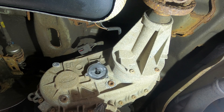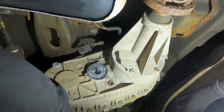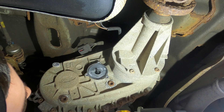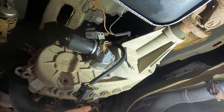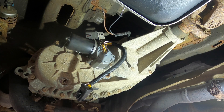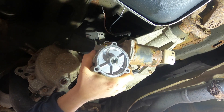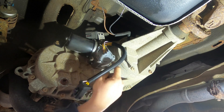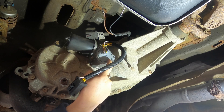Pull it and you can see — if you were stuck in two-high then you can just put the new motor on. My camera froze up just after I got this off so I lost some of that footage. But you can see the shape of that hole — it's almost an arrow. On the transfer case itself there'll be a marking for two-wheel drive, four-high, and four-low.